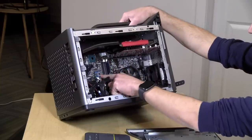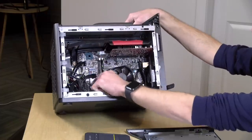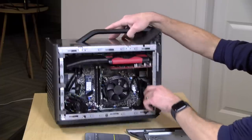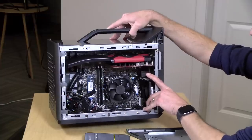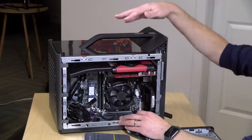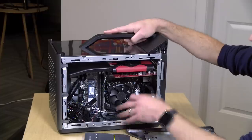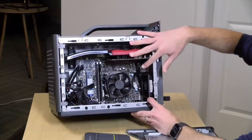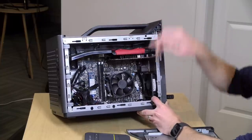Right here is where that Intel Optane module is — this one's a 16 gigabyte module. What it does is give you faster load times for things you're running on the computer frequently. You can't really manually configure it; it sits in the background, looks at your behavior, and tries to put frequently accessed things into that memory so they load up quicker than the spinning hard drive can. So if you want more storage but you like the way an SSD feels, this kind of gives you the best of both worlds — at least with the applications you load frequently.